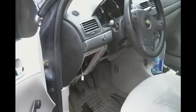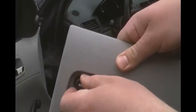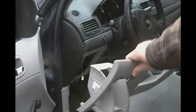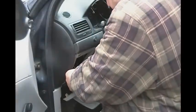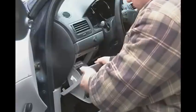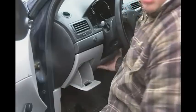Alright, it's been a while now since the motor's been put in. I think it's fairly sound. So I'm going to take the trunk release switch. Yes, I had already put a little dielectric grease in there. Push it in like so. Just like so. There we go. No great shakes. Pop the connector back in. And you just make sure all your clips are lined up, because the thing that this clips into is also plastic. You don't want to break that.